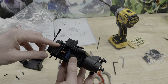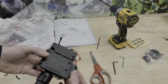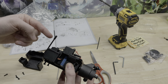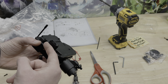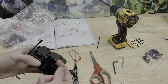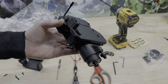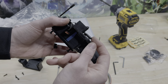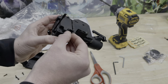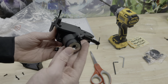You can see the wire coming out of the receiver box. This area is normally for a switch mount for one of Arrma's ESC or the Spektrum ones, but since I'm going to use a Castle one I didn't need it. This receiver has two antenna wires and they need to be perpendicular, so I thought this was a perfect spot to put that other antenna wire sticking out the side. I put a washer before one of these screws so it raised the screw up a little bit — the screw only comes down to hold that in place slightly, not impacting the wire at all, still nice and free to move around.